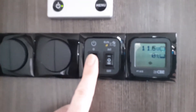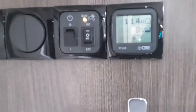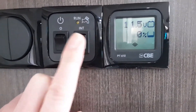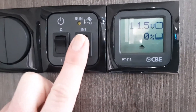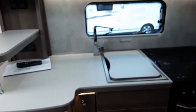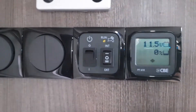On this control panel here you've got power for your water pump. You've got internal run — the internal water pump is now running so that will fill the onboard water tank. If you go to external, it will fill from the aqua roll on the outside of the caravan. Whichever tank you're using, you will need to have the taps open — whether it be the sink, the bathroom, or the shower — so they bleed through the system completely.